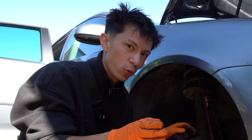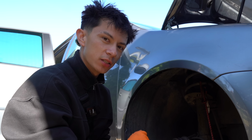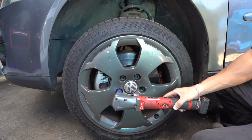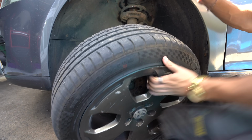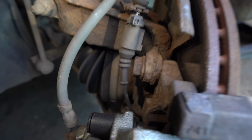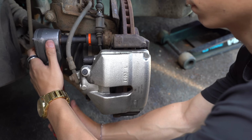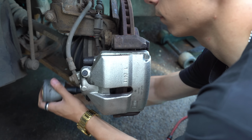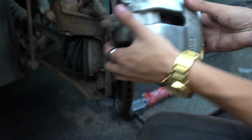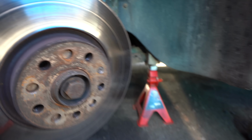But Silverstone is a super quick circuit, so we're going to need some good brakes, and that's why we're taking these off and replacing them today with the ProBike ones. Do not do this, but if your missus ever does piss you off, whip that retaining clip off, and then you've got 2 caliper carrier bolts at the back. And once we've undone them, we can actually just take off the brakes. She ain't going nowhere, mate. Of course, again, don't try this at home. These little retaining screws are an absolute pain, so I'm not taking no chances.